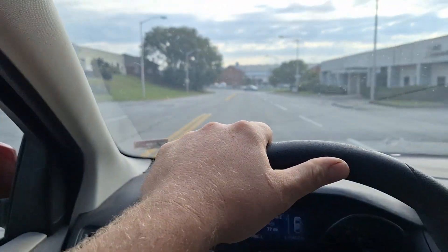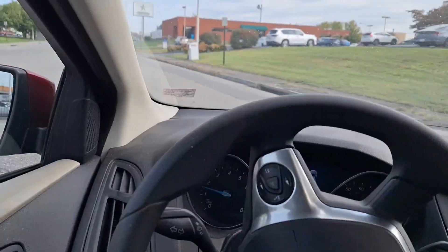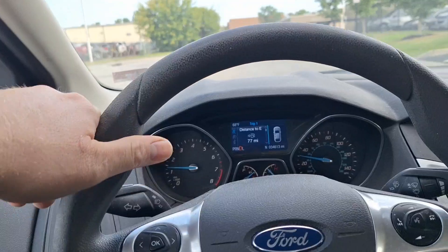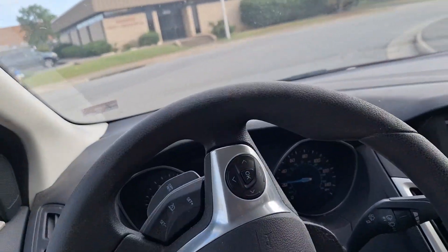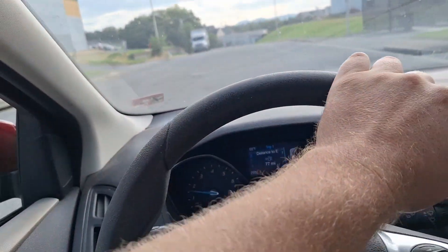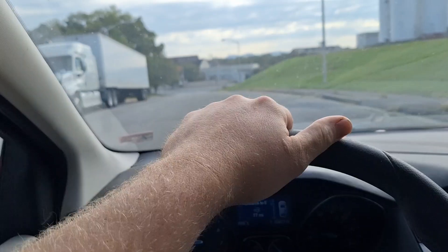If you do not have actuator codes, or you have friction element apply time codes, that's going to be a clutch and fork issue. You may have P07A3 or P07A5 as clutch fork issue codes — general apply time range codes. And if you don't have any codes at all, like this car, you may just have a general clutch failure or you may have input shaft seals leaking onto the clutch. Either way, you'll need a clutch, input shaft seals, the forks, and a slave cylinder.